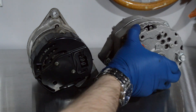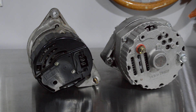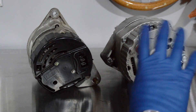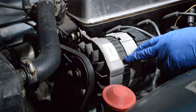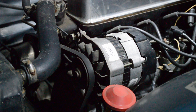Generally speaking, you have the spinning bit in the middle — that's an electromagnet that needs 12 volts, because otherwise the electro part of the electromagnet doesn't work and you've just got spinning metal that does nothing. You energize that — that's called the field. Around the outside of the alternator you see this black ring; that's called the stator. If you remember your high school physics, when you pass a magnet over a wire it induces a current in that wire.